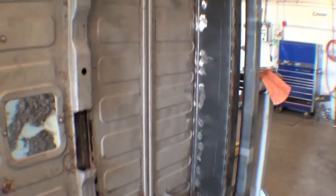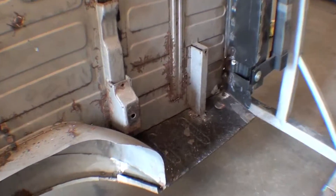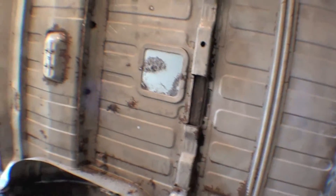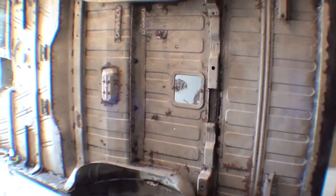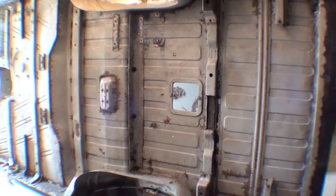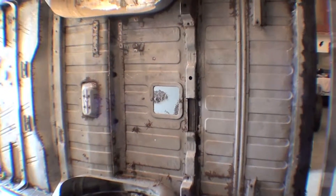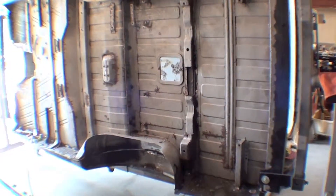Some of our earlier work — and here's our crossmember in the back that we created. So we're in pretty nice shape here, and we're glad we're taking it off. But it was kind of interesting to pull off the linex underneath here. We were able to peel it all off, and shazam — we have sandblasted, unprimed metal. Down the road that's going to be a problem, but not now that we've been able to access it. And then we're going to media blast it as well.